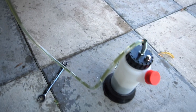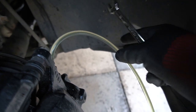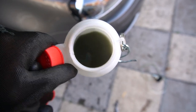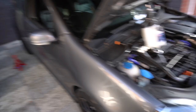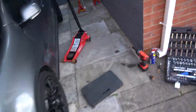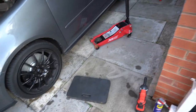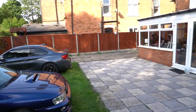It's kind of manky - yeah, so much air in that one. Now it's nice and clear - I'm kind of getting the hang of it now. Opening the top to look at the fluid that came out - you can see it's filthy, so there was definitely still a lot of old fluid still in the car. I'm going to put the front two wheels back on now just to make it easier and less chance of anything falling over. We'll jack up this wheel first and then continue with the bleeding.